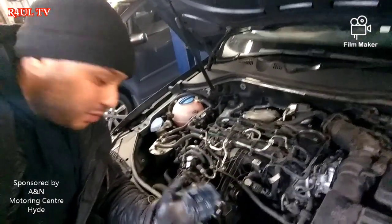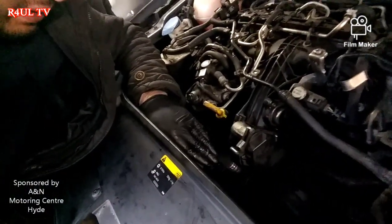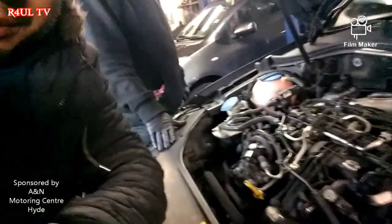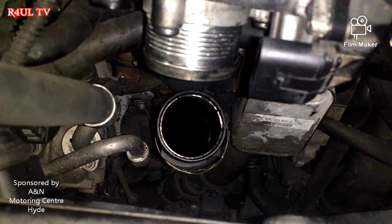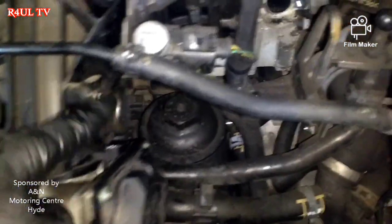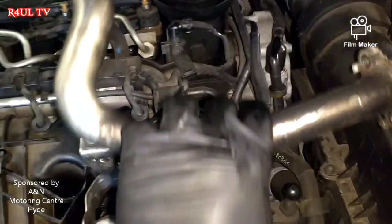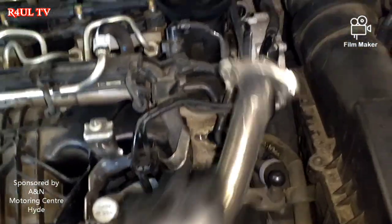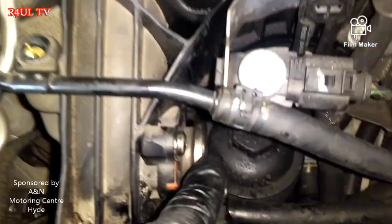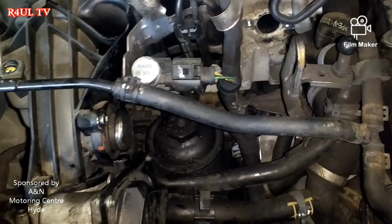We're nearly on the homestretch — that's back on. I'm getting the pipe back on as well — the metal pipe, which is the hard one. I cleaned it up while I had it off. That one goes back like that — they're all Torx 30 basically, except for the end here which is a size 5 allen key head. After that, start it up and see how it drives.